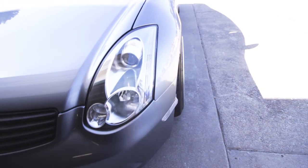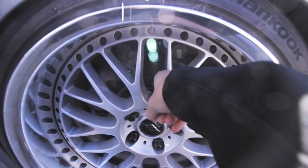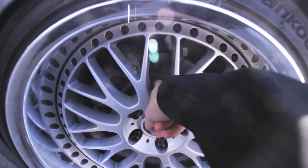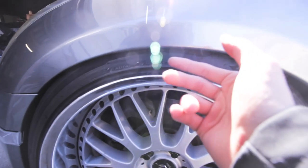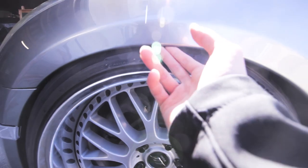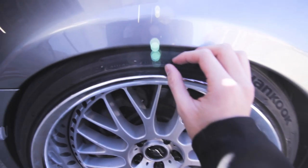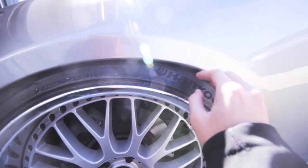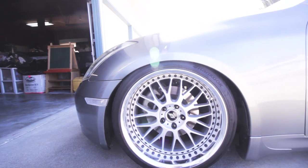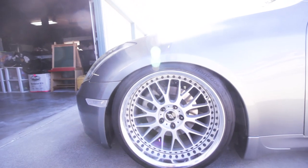After so long, I have the fitment that I sort of want. Right now I have two spacers, a 20 millimeter and a quarter inch. I might just round that off to 30 and add the camber I need to compensate. These are nine and a half up front with a plus 17 offset and 225/40/19, and I love them. It raised my car indirectly — I'm probably about an inch off the ground more. I might go lower, I'm just not sure yet.